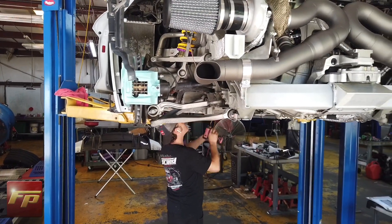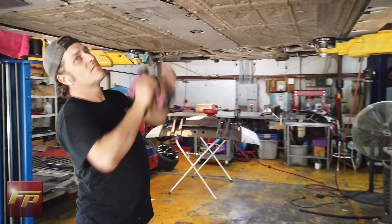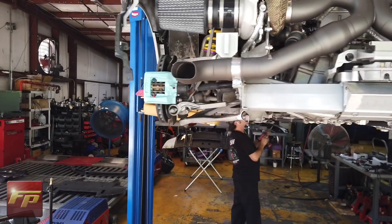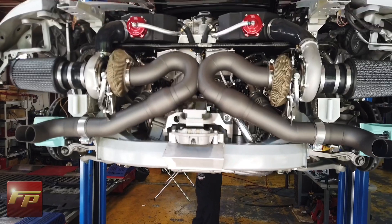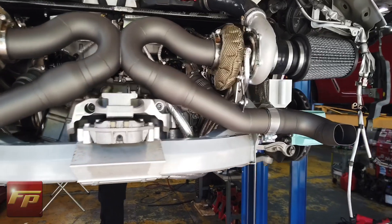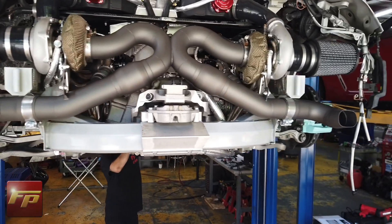All the wiring is done and we're just moving on to the final finishing touches of the build. Greg has trimmed out the underpan to fit the wires properly and is getting the last few bolts installed. We've also installed the tips on the exhaust and reconfigured everything so it all fits properly — when we put the bumper on the tips will come through in the right place. The last thing is to trim the exhaust heat shield over the turbo kit to keep heat off the bumper so we don't risk melting anything. That's an optional step, but after years of racing with the GTR platform we know what heat does, and we intend to do the same with the R8 and Huracan.